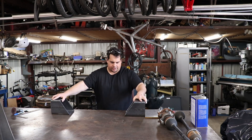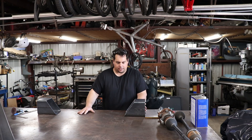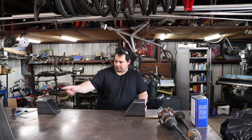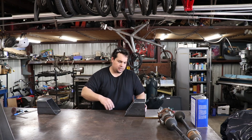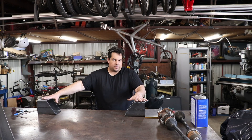These two tubes sit roughly like that. Basically, this is now my straight axle. I'll have this piece of three-inch box tube come out, go across here and come back in. And that is going to be my De Dion, or my dead axle.